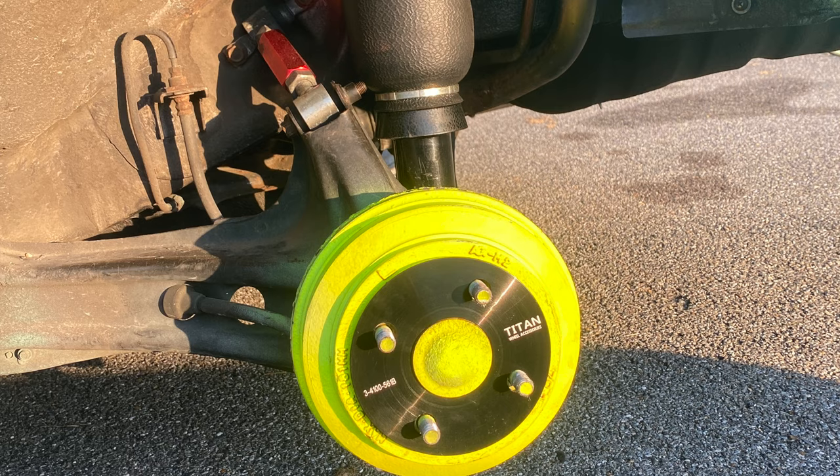You're going to need spacers if you have a wheel wider than stock. I run 16x9s from Clutch and was super close to the bags in the rear — when airing up or down, the gap was so small I was scared I'd rub a bag. I bought hub-centric 3mm spacers on Amazon and put them on the back, which gave me a lot more clearance. When I took the wheel off there were no marks on the bag anyway, but if you're running a wide wheel, grab some 4x100 hub-centric 3mm spacers just in case.